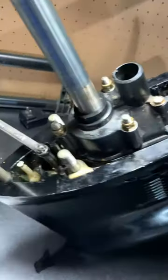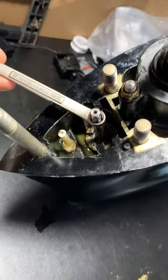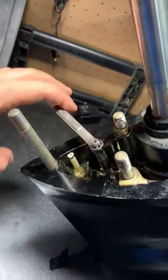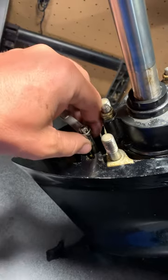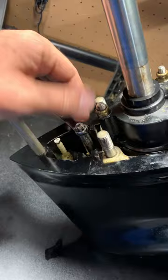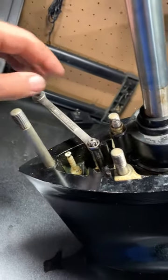Basically what I'm going to do is tell you that you have to take an 11/32nds of an inch wrench and put it on here, keeping it up toward the top. You want to make sure that you don't pull this shaft selector up at all — keep it where it's at. Don't push it up, don't push it down. Leave it where it's at, because you can actually cause more problems and disconnect it from the mechanism that hooks down inside of your gear assembly.